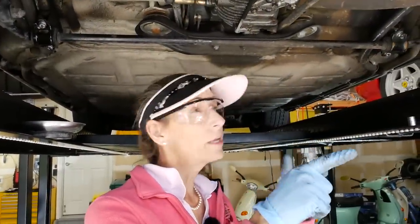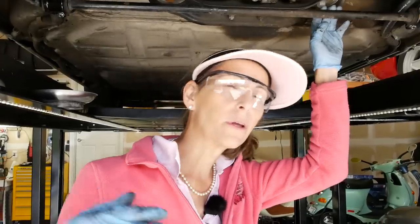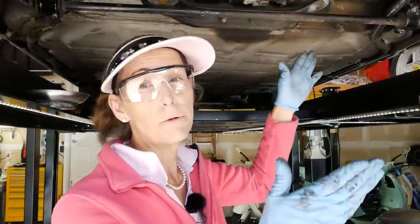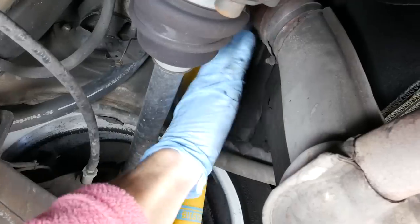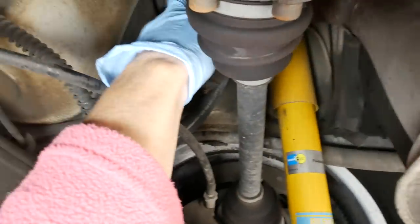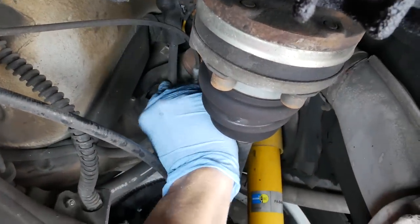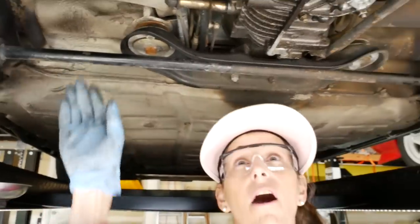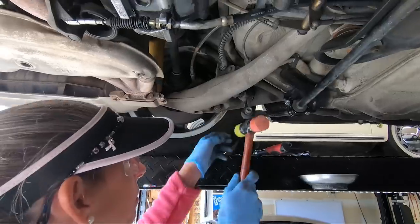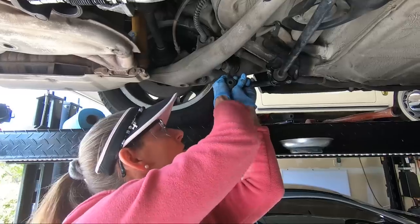With all the oil lines sorted, I'm going to work through a bunch of other things that need to get done. Since we're dropping the transmission as well as the engine, there's an additional set of things to do. This anti-sway bar has to come down — just disconnect it here and here. Over here is our clutch cable and we'll have to get that off. We've got heater hoses up here that have to come off, and up here is the solenoid for the starter — that big battery line has to come off as well. There's a ground strap up here too. And our axles have to come off.